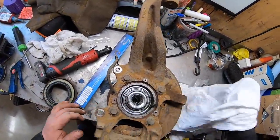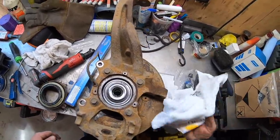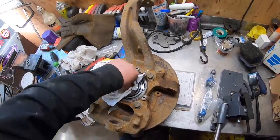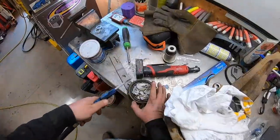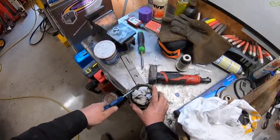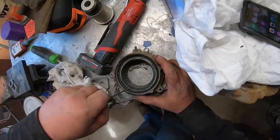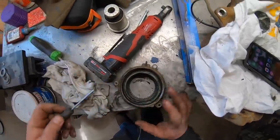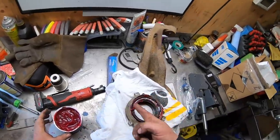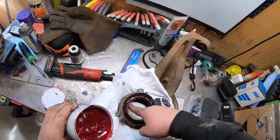You can tell right now that the grease is definitely contaminated with dirt and crap. When I put them in a few years ago they were white, and now the grease is all black. Let's clean that up. There's needle bearings in there — they're kind of wiping there too. Dirt is going to cause an issue where we're not going to get vacuum. Be liberal with the grease, don't be shy with it at all. Coat that grease everywhere that you can.